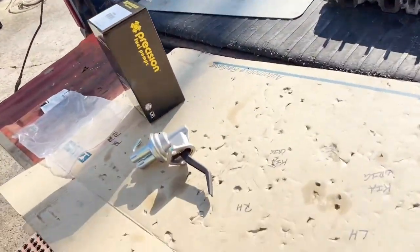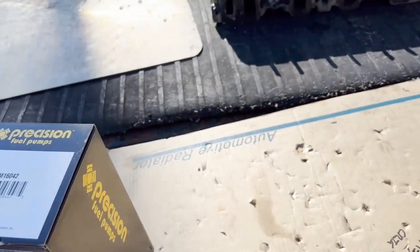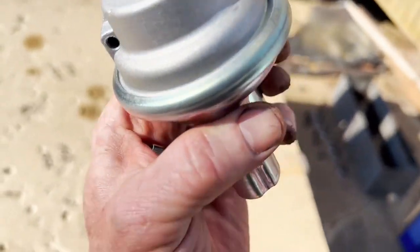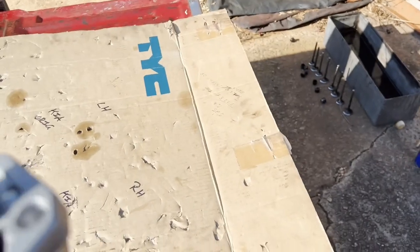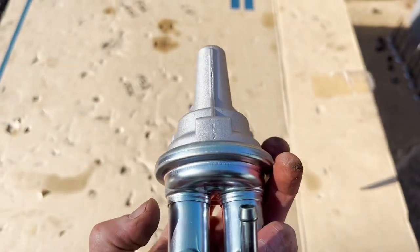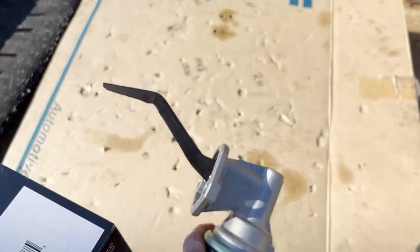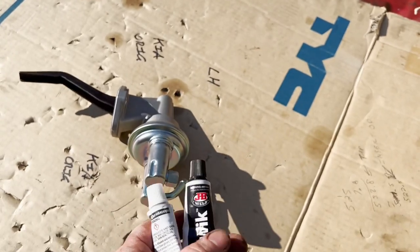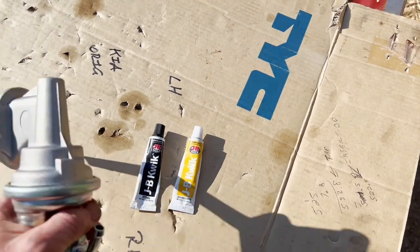Enough of that nonsense — let's get back to the fuel pump and the preventive measures to keep the oil leak from happening again. You can see where it's crimped together; there's really just a big gap in there, it just doesn't look like it's crimped all that well. I'm going to scuff this with some Scotch-Brite and hit it with some brake cleaner around the inlet and outlet housings and around the top. This JB Weld sets in six minutes, which is why I'm using it, though it isn't necessarily oil resistant.